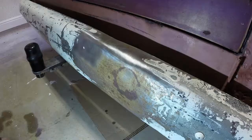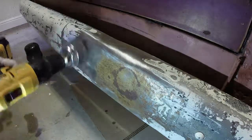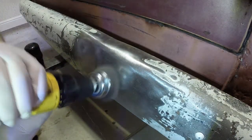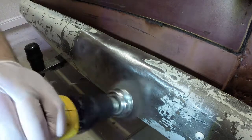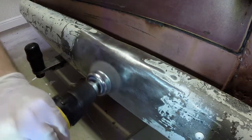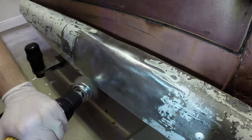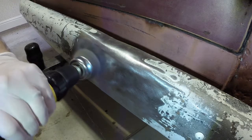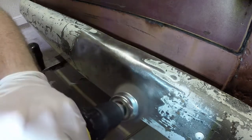After polishing, it was time to address the rust that had formed on the bumper post repair. I grabbed my drill and a cup-style finishing wheel, went over the whole thing, cleaned it up, and then I gave it a coat of WD-40 gel finish just to give it a little bit of protection and keep it from rusting in the meantime.